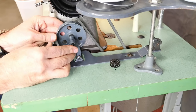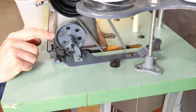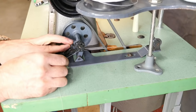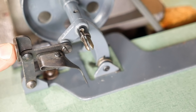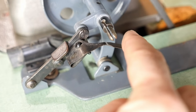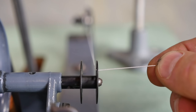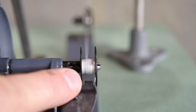We put that back together, tighten the set screw, and I've applied a drop of sewing machine oil right here. When you put the bobbin winder into the wind position, it brings this finger up — this is the finger that the thread pushes on to stop the winding process. As we load the bobbin, we can see that the thread travels from left to right.